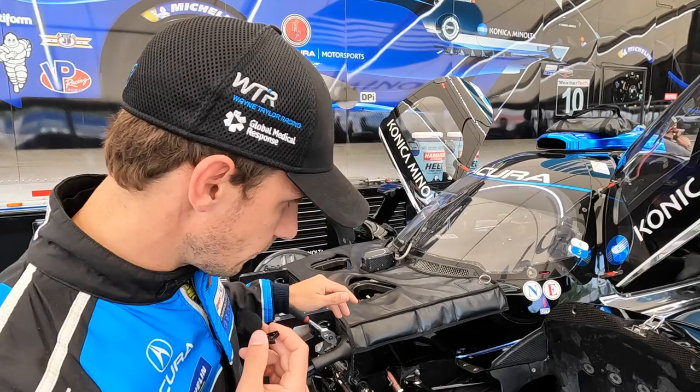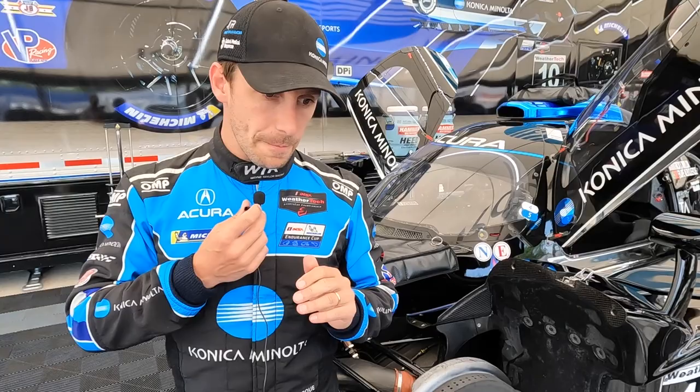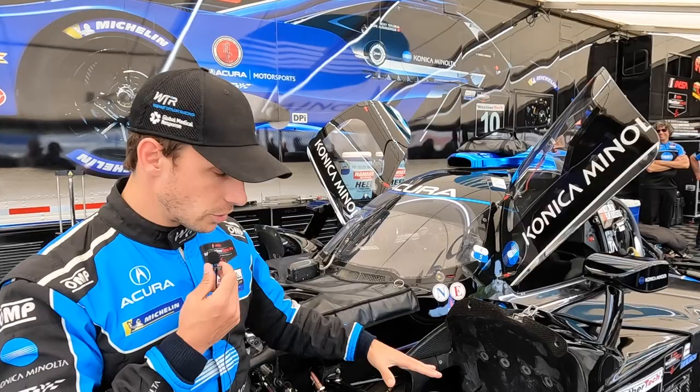And that's what's fascinating — on a road car you'll have something like 70%, even more than 70% of braking force on the front axle. So you still have all the weight transfer, but you have such much better weight balance that you can still use the rear brakes more effectively. Yes and no — but it's another very interesting topic on the brakes.